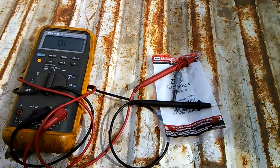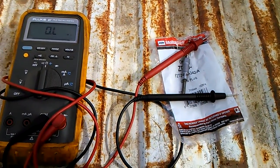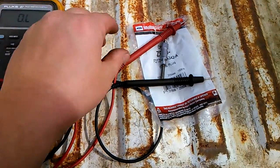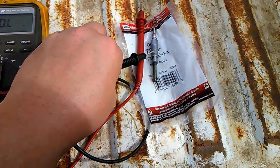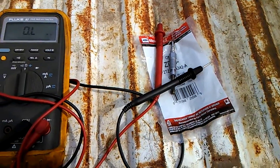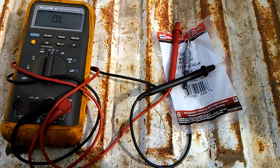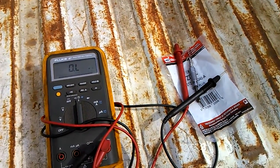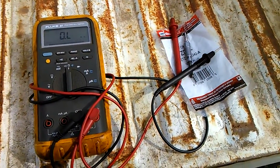And that's about it. A simple resistance test to test the glow plugs. You can do this test inside the motor, I guess. You can touch that to the lead, and you can just kind of ground it to where it grounds on the block. Make sure your surface is clean if you're doing the test on the cylinder head itself. But the winter coming up, I just recently checked my glow plugs, and even after a year, all my Motorcrafts are still testing at good resistance.